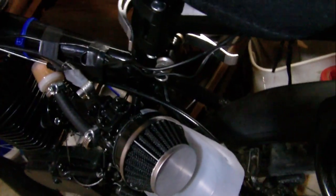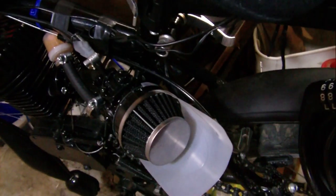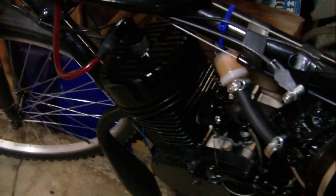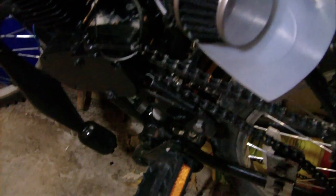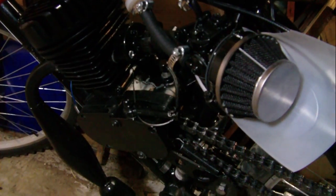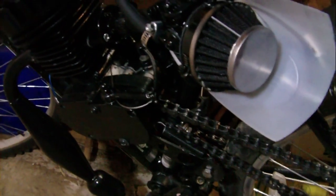The elevation in the LC Valley area is around 700 feet above sea level, and where I'm at it's 1,200 feet. Based on what I'm hearing from other people, I think I'm going to be using a .65mm jet. I've got the high performance head on because I thought that would help with the running-too-rich issue, but it didn't. The spring tensioner is great for break-in but at this point it does get in the way — once I can get the half chain link and spring tensioner off that might be good.